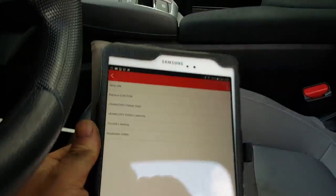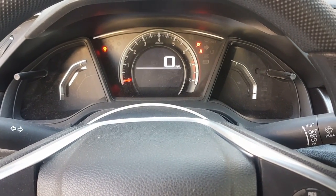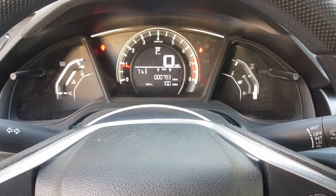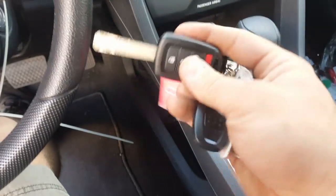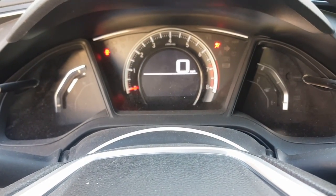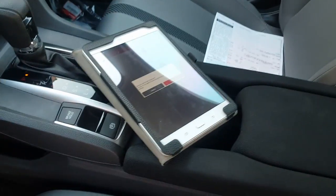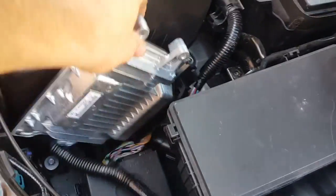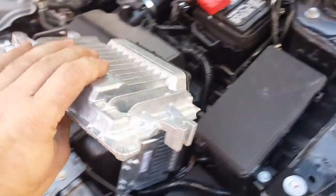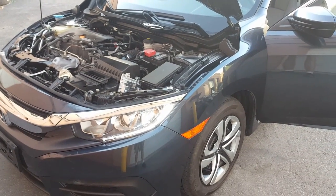I'll hit Yes and VIN writing is complete. I'll hit OK. I'm going to go ahead and start the car to try all the keys. Bingo — one key is running. I'm gonna check my other key. I just saved myself a couple hundred bucks, and on top of that I would have had to buy a PCM code, which I didn't have to. That's how you do it. This was George with Melnick's Automotive. As proof you can see my scan tool connector, my tablet, and my new computer attached to the wiring. This is the old computer I'm gonna throw out. Thanks for watching — if you have any questions, shoot me an email.